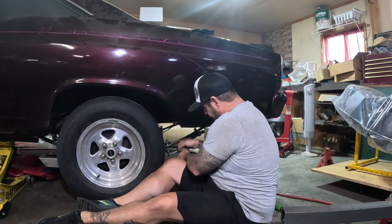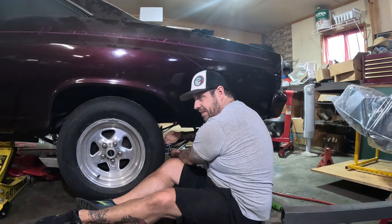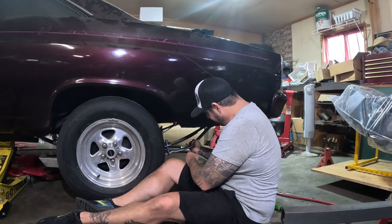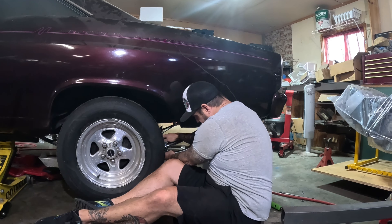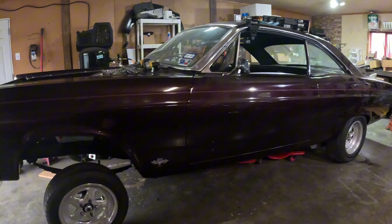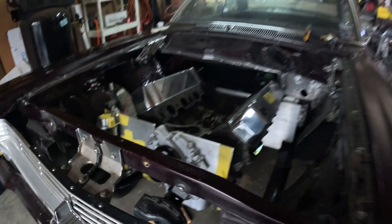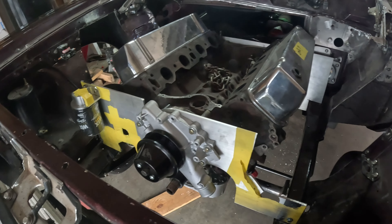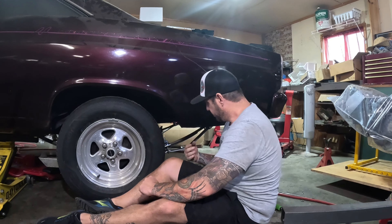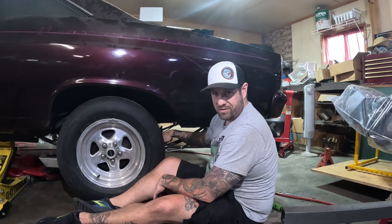You guys may have differing reasons for wanting to do this — most people just because their leaf springs are saggy and they don't want to spend hundreds of dollars on new ones. To give a little background on this car: this is my newest project, a 1966 Fairlane gasser. This is not a low-buck project, so these helper springs are not going to stay in here long term. I'm doing engine plates in the front, and you've got to set the angle that your engine tapers down. I want to get the body tilt angle closer to where it will actually live when I put real springs in. This will probably get Calvert single mono leafs.